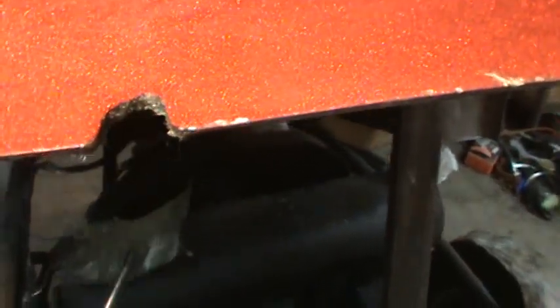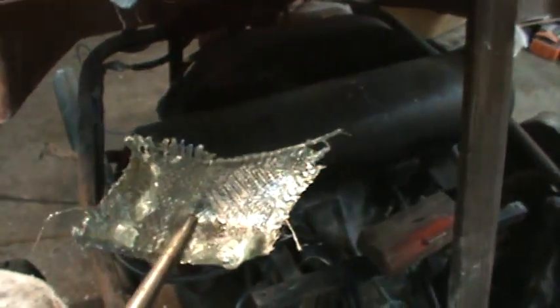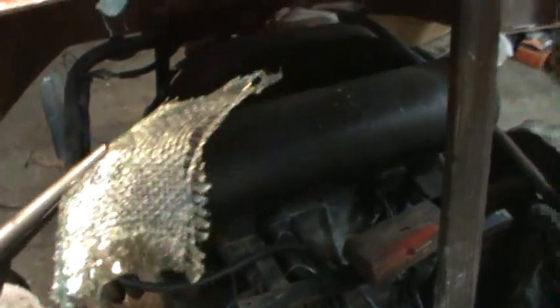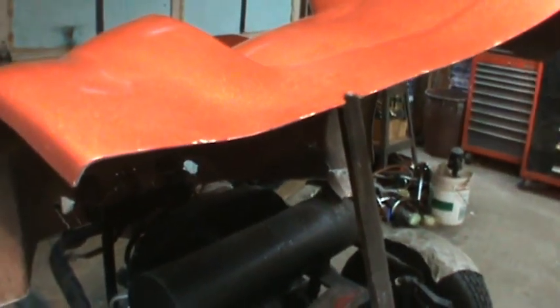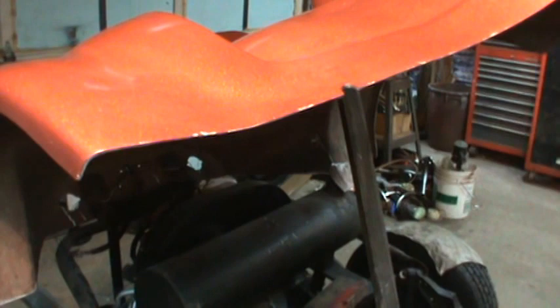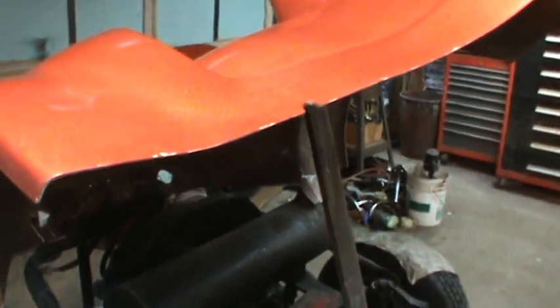That's crap. So unfortunately, this is not a think-twice bike, but I gotta do it twice. And so now I gotta go in there and try to get all that old material off of there. Probably a wire wheel would be my best bet. And I picked up some new material, and we'll see how that makes out and how that cures. So I'm gonna go set this back up, redo them again, and see what we get and go from there.